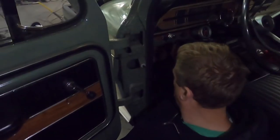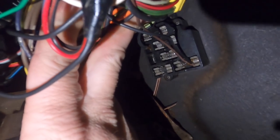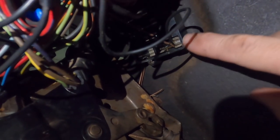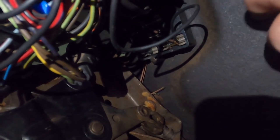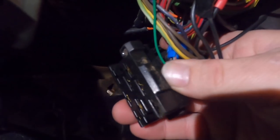We thought it might be a fuse first, but Matt found the headlight switch. Here's the old-school fuse box with glass tube fuses. I noticed there's actually a wire jammed into the fuse — a lot of people will jam a wire in between the fuse and fuse block to tap a power source, but that's really not a good way to do that. We'll pull those out and wire everything correctly. The biggest thing Matt noticed about the headlights: the switch just isn't plugged in.